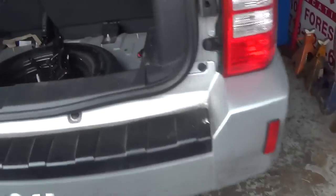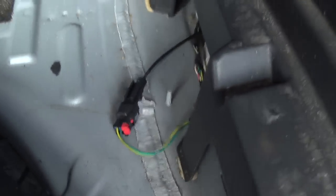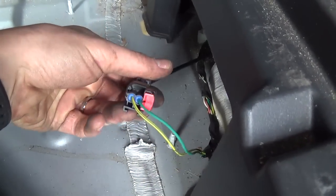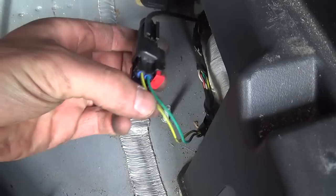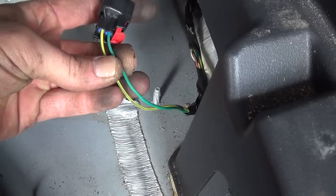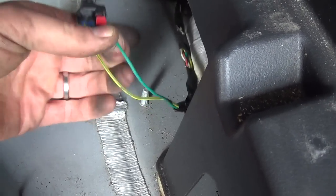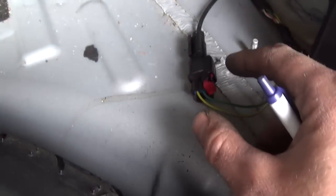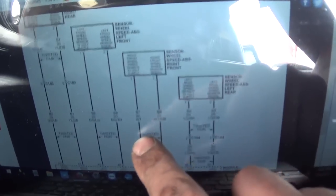Called up Keith, Keith sent me over here. Now I'm doing this post-diagnosis; I'm not going to show you too much — it's more of an approach to finding wiring problems. Here's our ABS wheel speed sensor. Two wires, it's a digital type. This yellow with a green stripe is just the ground, and the dark green with the light blue stripe is our signal wire. We're supposed to have battery voltage on here on a good system. Battery voltage with the sensor unplugged, and when you plug the sensor in it goes from like 11.5 to 10 volts.